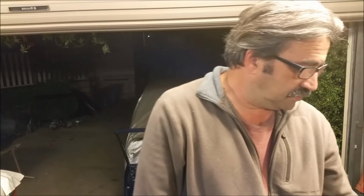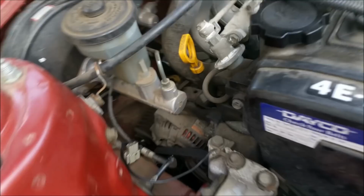Well, I've nearly got this the way I want it. You can see down there, you can see the top of the steering rack. I did manage to find the proper manual steering union. You can see it's got a small spline and a big one. Power steering has two big ones. These little guys have two little ones, and it's got an adjustable sort of slip joint there. But I'm wrapped, I got that, because it means I don't have to destroy the power steering ones.